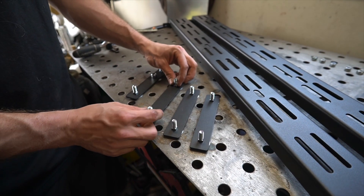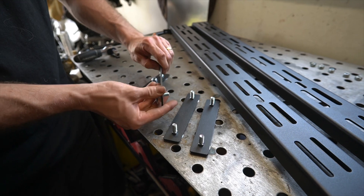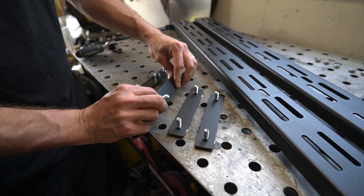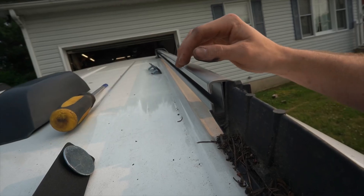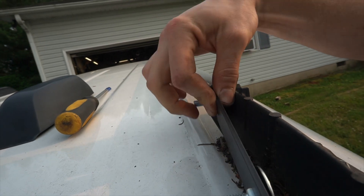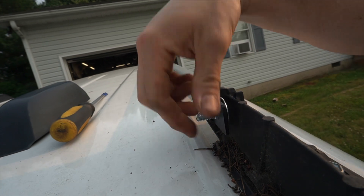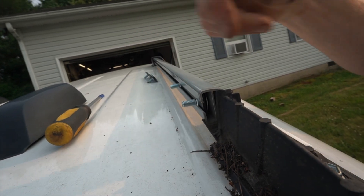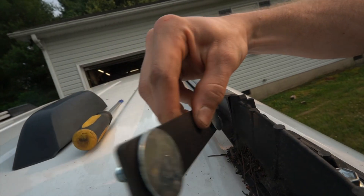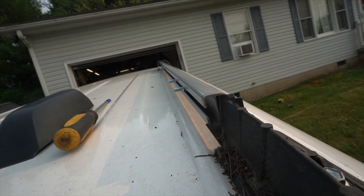This is our hardware and this is how the crossbars are actually going to mount to the rails. They give you these little elevator studs — that's what they're normally called — and they just slide into these little channels, and then we have a 13 millimeter nut. You can see how all of this is nice and exposed and then this plate can just slide in here super easy. You're going to need two per side — go ahead and slide these in, and since this one will be for our front, slide that towards the front of the truck, then put in the back one and repeat the same for the other side.